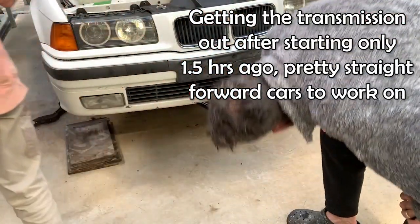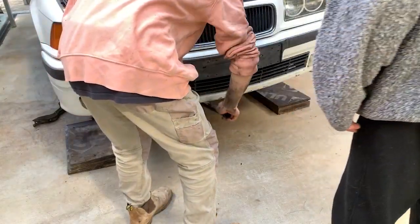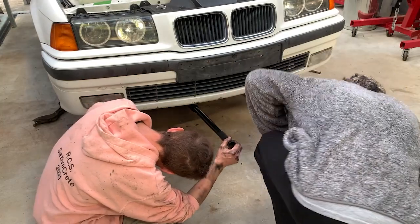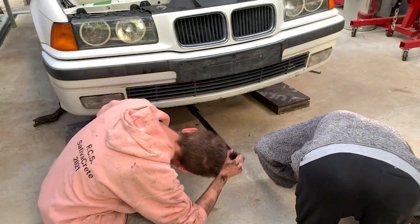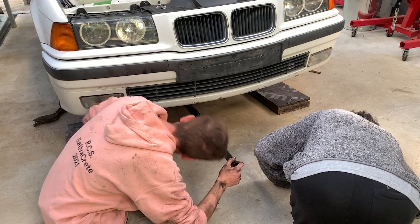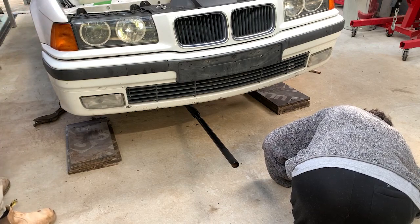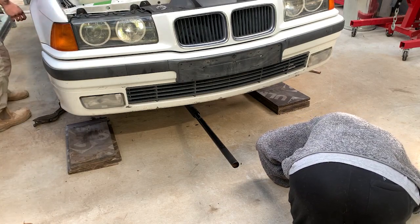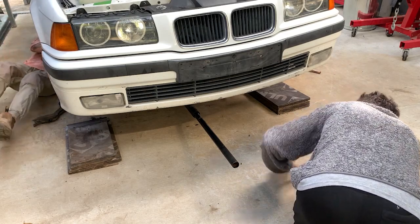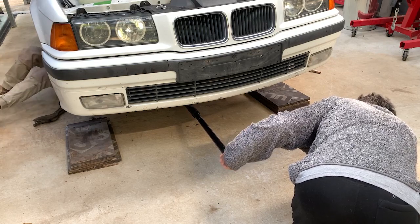Under there, and so I want you to raise it just a little bit if you can. Okay. So I'll show you. You can see if you look underneath, you can see the mounts are close to the car. See those mounts moving? Yeah. So I'm just going to move them up to there. I'm going to try and wiggle it out with the jack supported on it. I just need you to lower it. When I tell you to, bring it out front. Okay. Yeah.